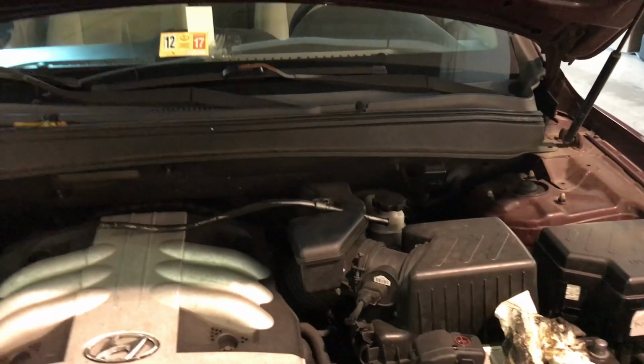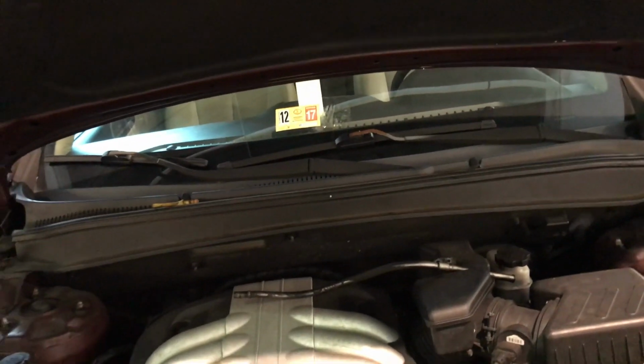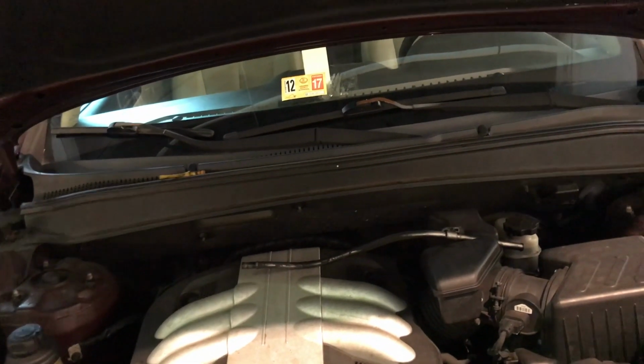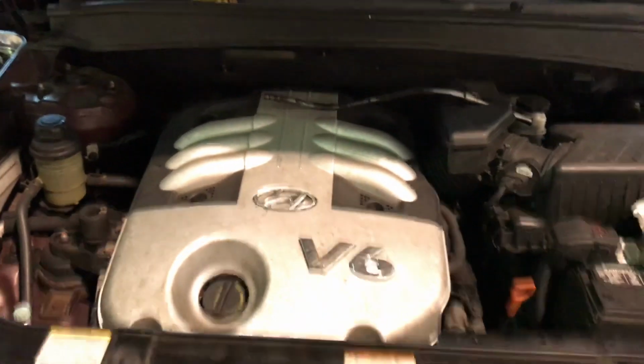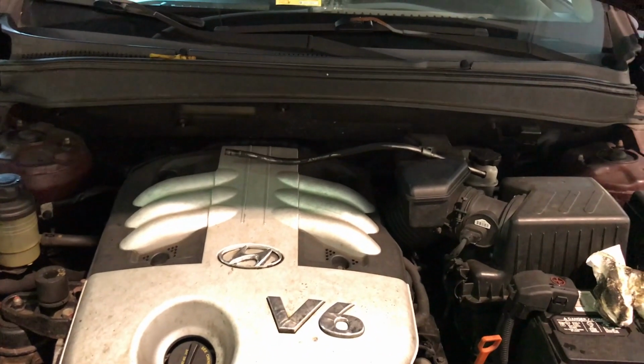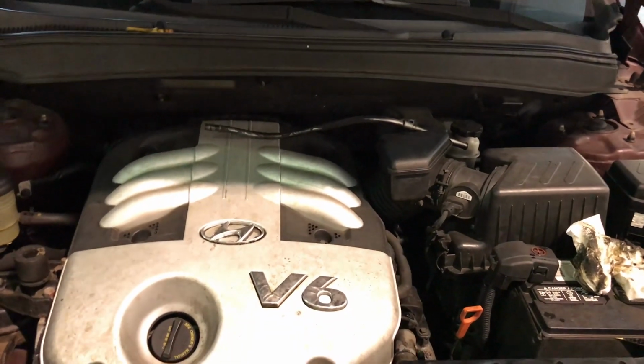And then as soon as I put all the lights and radio and fans on, it went down to like 12.2. So bad alternator. This is the reason for this video. Just wanted to give you a little bit of what the problem was.